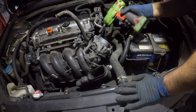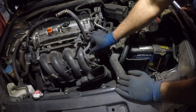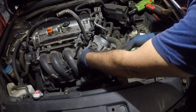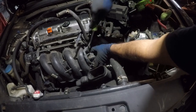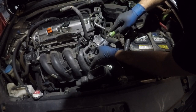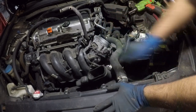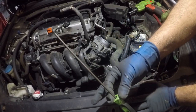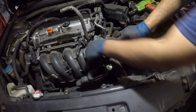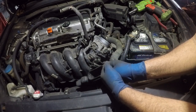I'm going to take off the number 12 from the throttle body — the throttle body will stay to the side. But before that, let me disconnect the MAP sensor — Manifold Absolute Pressure sensor. All you need to do is disconnect this connector. It's not going to be easy because it's been there for a long long time. I'll use a snap-on pick to lift the little locking tab on the connector.